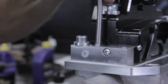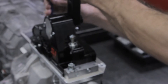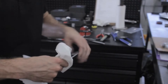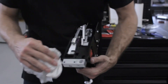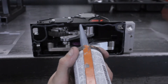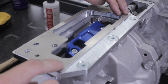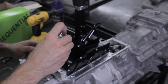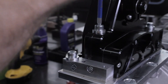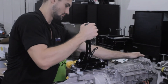If all is good, it's time to remove the shifter and reinstall with sealant. Punch out the roll pins and remove the four bolts holding the shifter on. Remove the shifter and the shim. Clean the surface of the base plate, shim, and shifter, and apply a thin bead of silicone between the base plate and the shim, and between the shim and the shifter. We will install the shim and the shifter the same as before. Once the shifter is down, thread in the four shifter bolts but don't tighten them yet. Now install the roll pins and tighten the four shifter bolts. Your shifter should now be locked down and shifting smoothly.